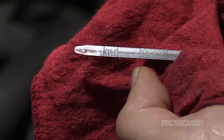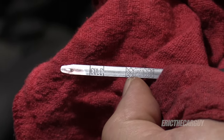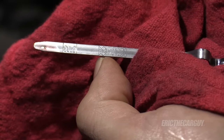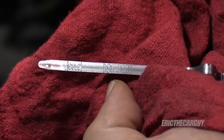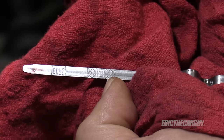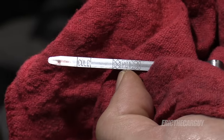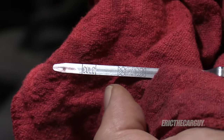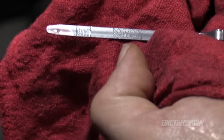Here's a little tip about when it's low. Usually in my experience, from the bottom of the hot mark to the top on the dipstick is only a half a quart of transmission fluid. So don't add a full quart if you're down here. Add fluid a little bit at a time — if you put too much in it's really difficult to get out.